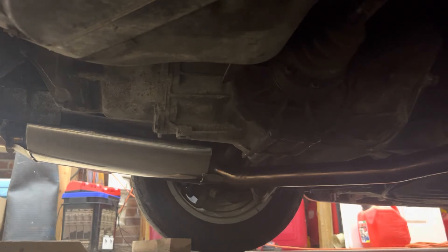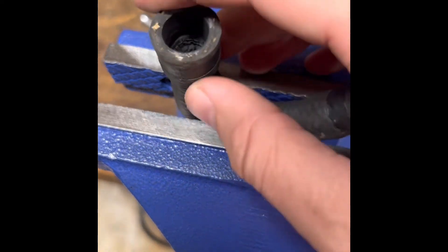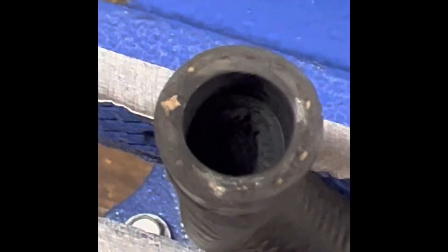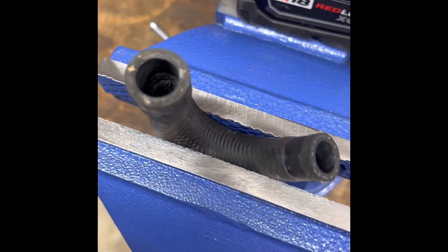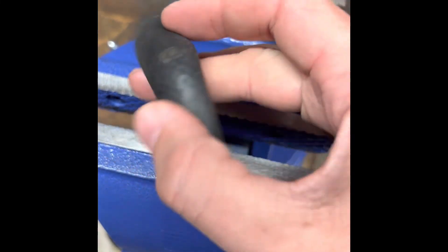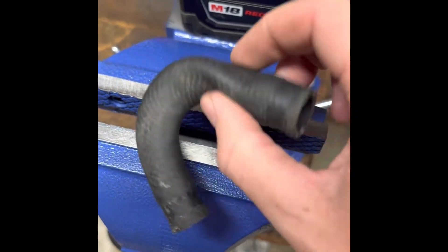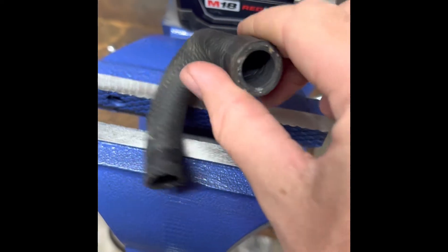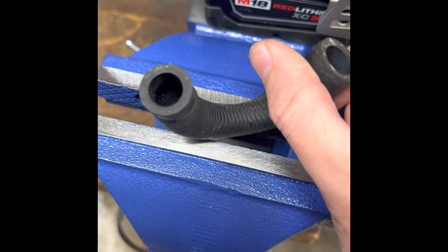I'm not sure yet. I've got a new fuel pump on the way, so that's a whole different thing I haven't done before. If your fuel pump is going bad, I highly recommend getting a new gas tank to fuel pump hose, because we now have ethanol and having a hose rated for ethanol is important. Also, when a hose like this gets crimped or clamped it actually damages the wall, deforms it, and could close up on you over time. For 30 bucks I got the OEM one, which I think will be well worth it going down the road.